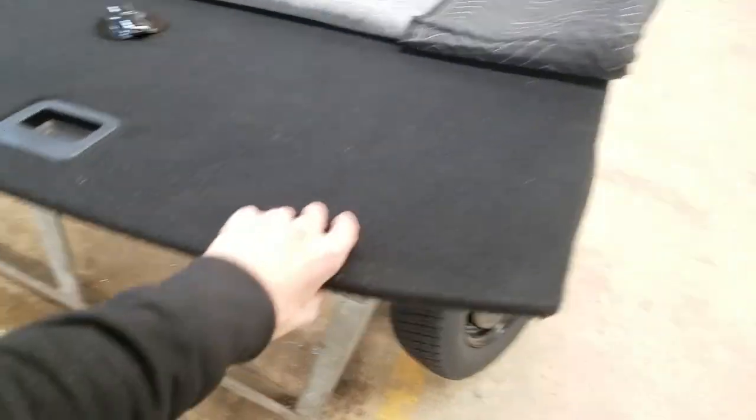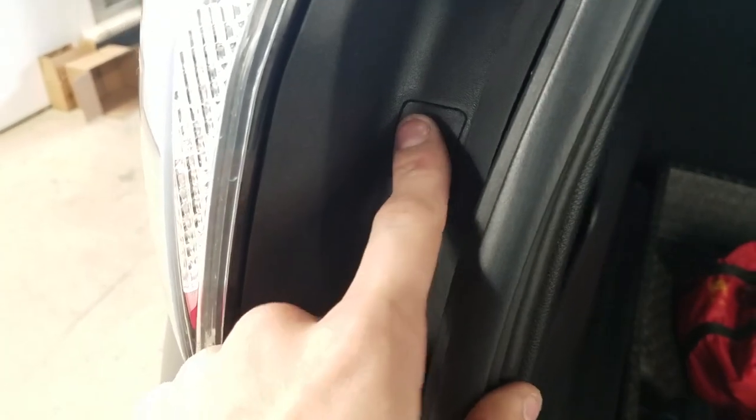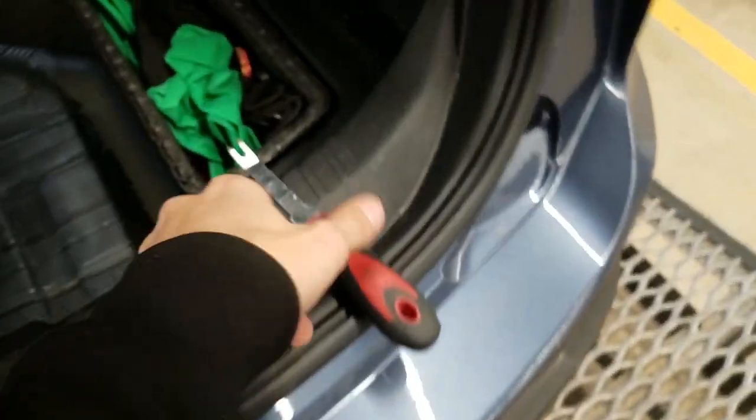To start, you're going to have to remove the spare tire, all the insides, as well as any customer goods. What we're going to do is run the wires down through here and take the tail lights off. One issue I ran into is it is very hard to get this tab out — I went ahead and used a trim tool to get that out.